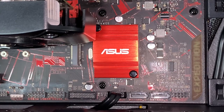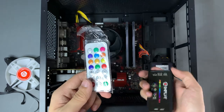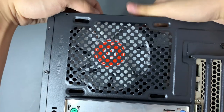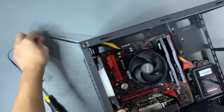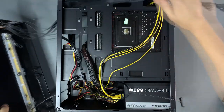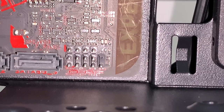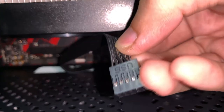All that's left to do is plug in the front IO. But before that, let's install a fan at the rear. This is an RGB fan — it comes with a remote, a fan hub, and the screws. The face of the fan with the shield blows air while the exposed side pulls air. We're going to orient this fan as an exhaust, so the shielded side would be facing the back. Screw these in and route the cable through the back, then plug the fan into the fan hub. Finally, route the front panel cables and plug them into their respective ports. Don't hesitate to read the motherboard's manual — there's a diagram near the front IO pins on the motherboard that'll help you know where to plug them in.